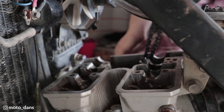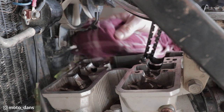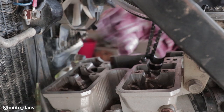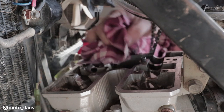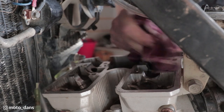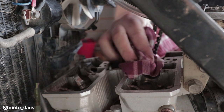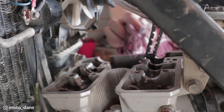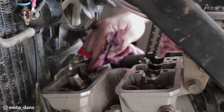Now if you did have to adjust your valve clearances, what you do is the wee valve buckets here - take these out and there'll be a shim under there. You measure that shim and then it tells you how you'd have to either increase it or decrease it depending on what your clearance was. As I said mine were all good, so all I'm doing is just giving it a quick clean in here with a rag, checking all my surfaces - everything looks actually pretty bloody good in this bike.